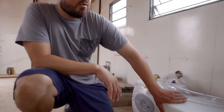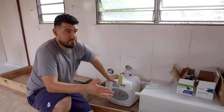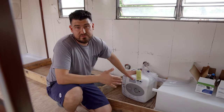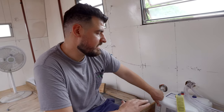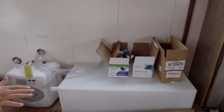We ordered a 30-gallon water tank, about the same size that was in here before, and we're sticking to the same idea of storing the water tank inside the couch — it's a great space-saving idea, keeps it out of the way but still accessible. We also ordered our water heater. We went back and forth between electric and propane and ended up going electric — we think it's going to be a lot easier. It runs off 120 AC, which we have the inverter for. It's really compact and all of the water system, the pump, all of that is going to fit right into our sofa.